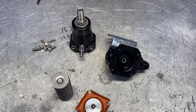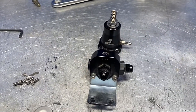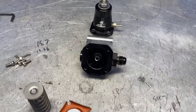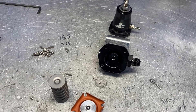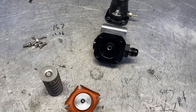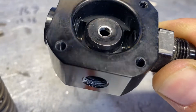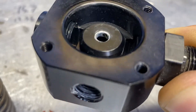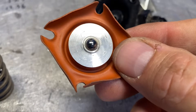The easiest way to do that is to not buy an aeromotive regulator for your Yamaha side-by-side. This is a mini regulator — I think the part number on this one is 13136. All of these mini aeromotive regulators work the same way. Now let's talk about the mechanical design of this thing and why it's not very good. These regulators are not inexpensive — you're still paying $150 to $225 to get one depending on who you get it through. It's this soft aluminum base with this hole in it. This is the one that came off our shop car and this thing has failed. You can see if you look at this ball seat, it is absolutely just beat to heck — it's not round and it's smashed out from this hard steel ball bearing pushing against it.